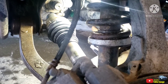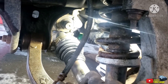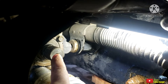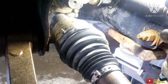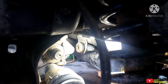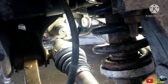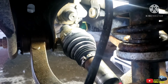So what caused this? I know I should have replaced it from the beginning. What caused the CV axle to pop off was the snap ring. I did not change it — there's a snap ring in there right here. I reused the old one, just took the old CV axle off, popped the new one in, and did not change the snap ring. And that's what happened: when I turned the wheel it stretched the CV axle out, it popped itself, lost tension on the snap ring, and the CV axle came off.